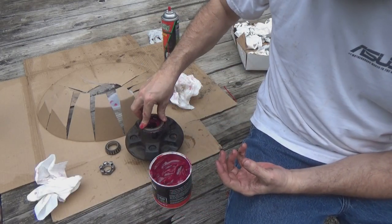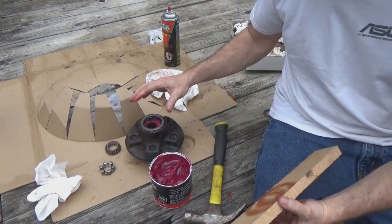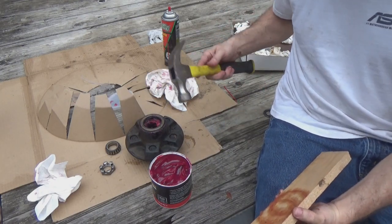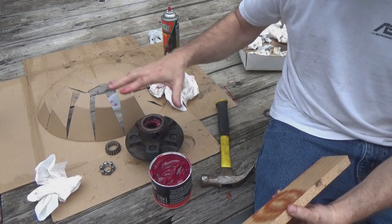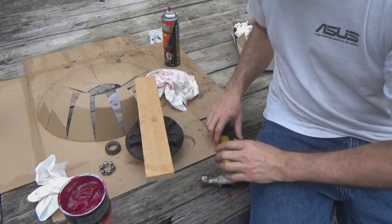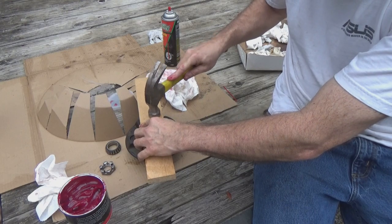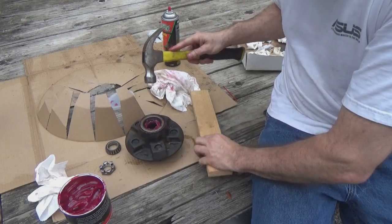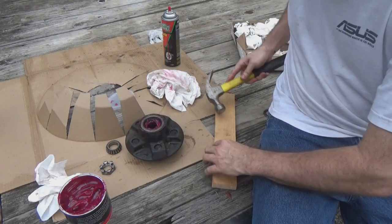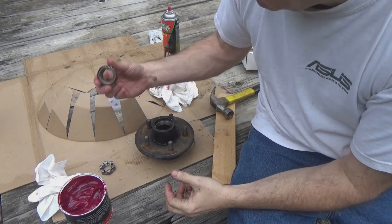With a good coating of grease inside the back side bearing, drop it into the hub where it sits. Add some more grease on top and then put the rear seal on. This is where the board comes in handy — I want the seal to go in nice and even. If I just tap around the edge I'm not putting even pressure driving it down, so I use a board to apply even pressure all the way around. Just tap it in lightly — it doesn't take much. Now we're packed on the rear side.